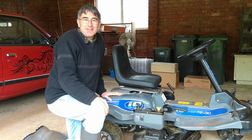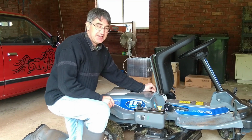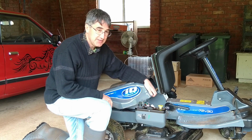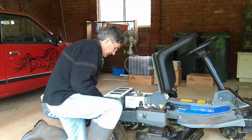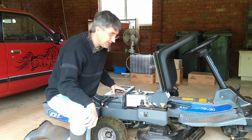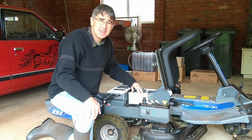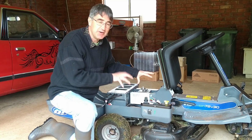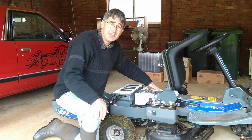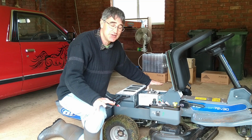So there's some interesting stuff under the rear cover here. Let's have a look. The single nut here, which I loosened earlier. This nice metal cover. Hinge is open. So in here we have our 72 volt battery here. We have two controllers on this side. One says left controller, one says right controller. So they'll be for the two blades, one motor each. And there's another controller on the other side, which is for the drive motor. Got three separate motors, three separate controllers.